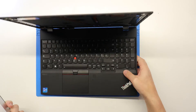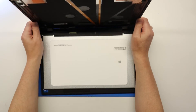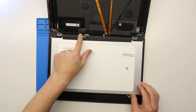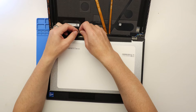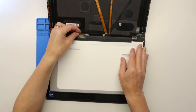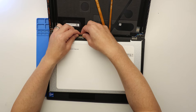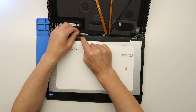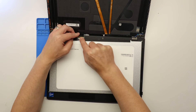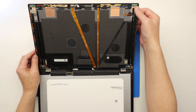Place the laptop the right way up, place the screen on the keyboard, and push the lid back a little bit. That gives us easy access to connect the cable to the actual screen. Grab the cable, pull back the little metal bar, and then slide the cable into the connector. Push down on the metal bar — the locking bar — so that locks the connector. Then just put your tape back over again. We've already got our tape in place to hold the screen.